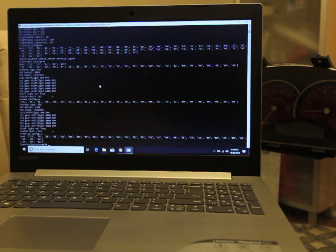So basically we've gone through all the basic settings. We set the HSV serial number to 2005, set the HSV startup screen, set the cold shift light to 500 RPM, first gear through fifth gear to 6000 RPM, the shift light is on, and our custom text says 'LS2' since it's going into an '05. You are limited on characters, so you have to get creative. We'll flip back to the cluster, power cycle it, and show you what it looks like once programmed.